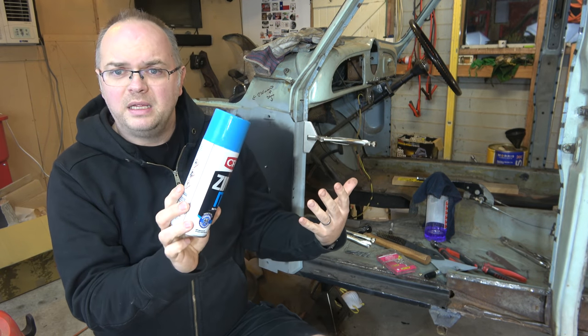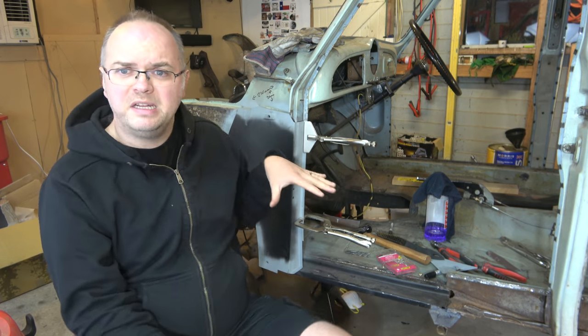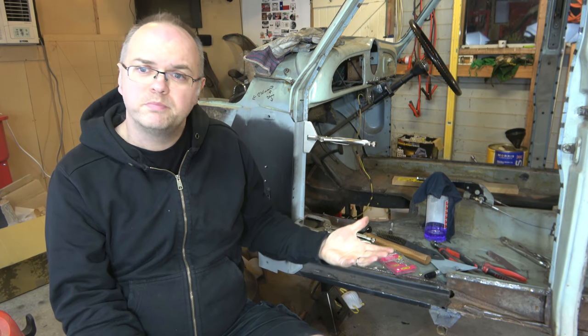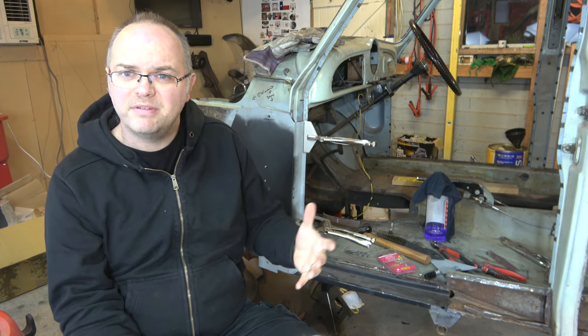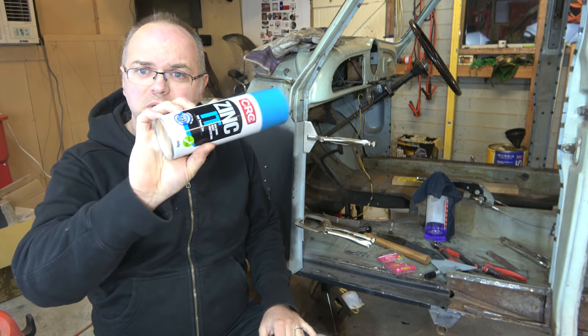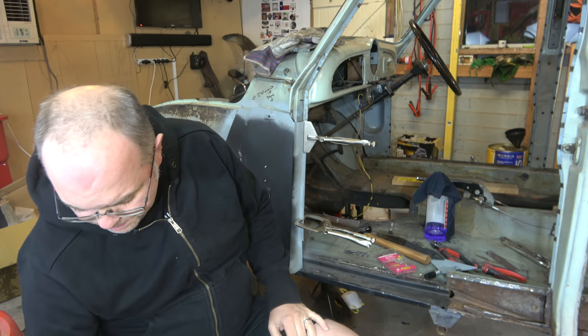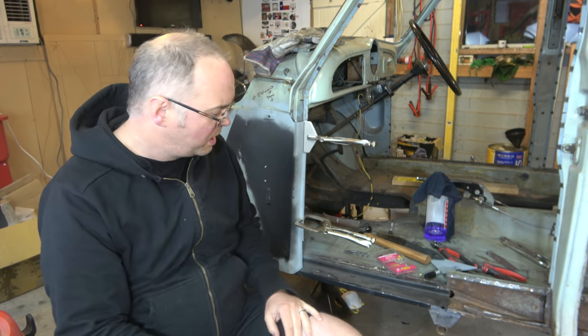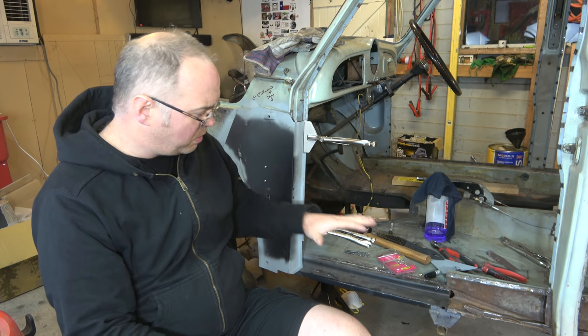give this another layer. All of these cavities are going to be filled with fish oil. That's what we use over here for rust prevention as a cavity oil stuff. But yeah, so got this at least, which is decent protection. We're sticking that on all of our hidden panels, all of our welded bits. Get this all lined up.